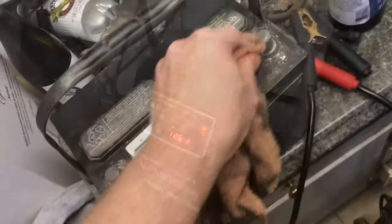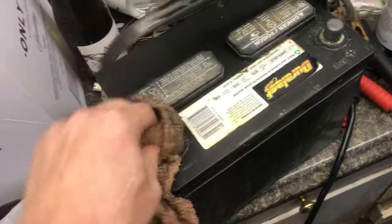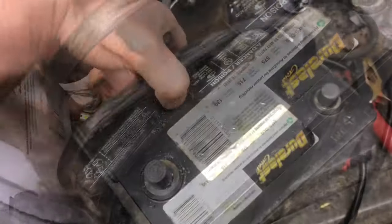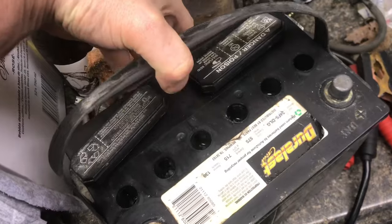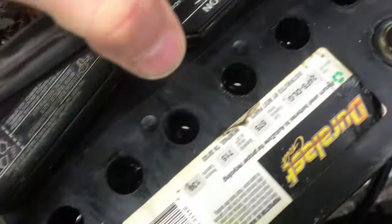Overnight, it's still working but not fully charged. Clean everything up and check the electrolytes — if the electrolytes are low, it'll never recover. Make sure everything's really clean; you don't want any debris in there. Pull up the tops, make sure no debris falls in. It's good that we've got water in all the cells. This last cell may be a little low, but it's definitely hydrated.